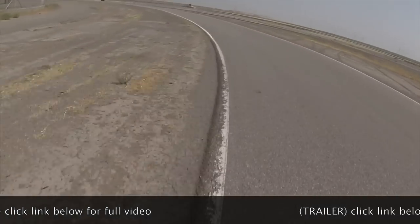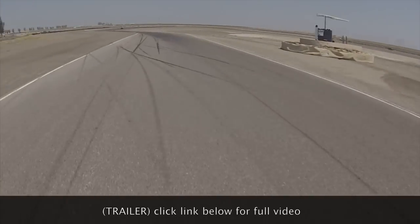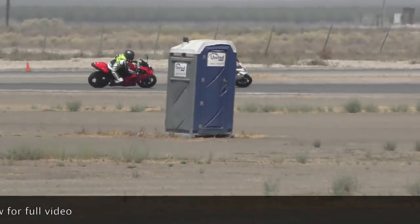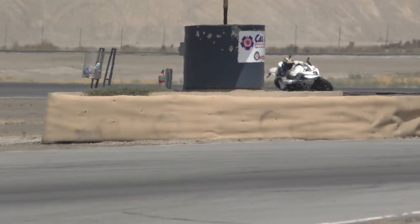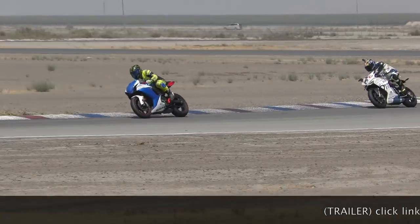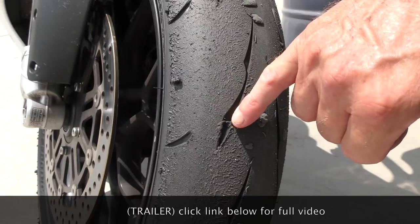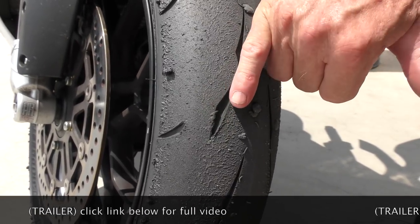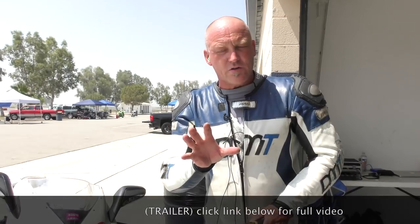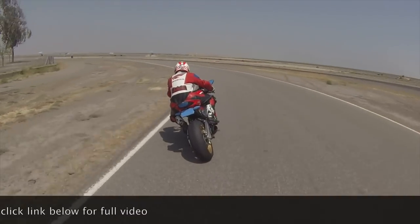Now on our third run, we've got to get that rear tire temperature somewhat close — 200 plus. On the inner edge there's massive rubber buildup, which peels right off. We can see that the sidewall would flex but the carcass would hold. We were at 79 degrees this morning and now we're at 130.